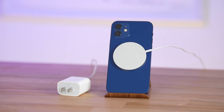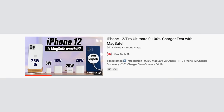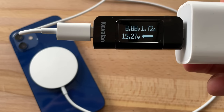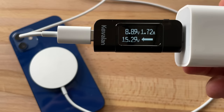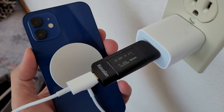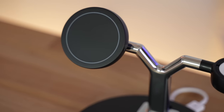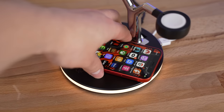However, this isn't a big deal for two reasons. First, you're not always getting the full 15 watts even with Apple's own MagSafe charger and 20-watt brick. We did a video testing out a bunch of different charging methods, and we saw that Apple's MagSafe only charged at 15 watts until about 20%. After that, it gradually lowers the wattage itself, and then after about halfway, it only charges closer to 6 watts. But getting back to the stand, it's mainly for nighttime charging when you're asleep, so it doesn't really matter how fast or slow it charges. Keep all of that in mind when shopping for any MagSafe charger in the future.